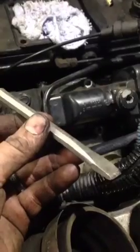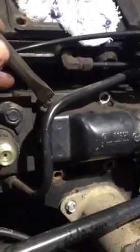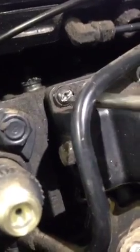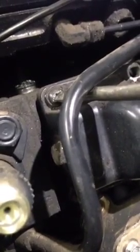This is on P-pump trucks. I just use a cold chisel like this and stick it down right behind the fuel line, right on top of that safety bolt head, and smack it until it looks like a flat head screw to remove it. So once you've basically cut that slot in it, put your screwdriver in there. A lot of times just the jarring from hammering on it loosens it up.